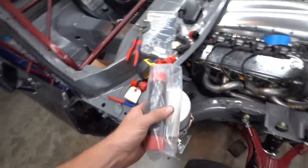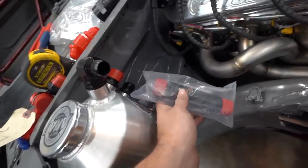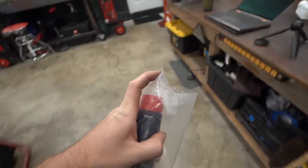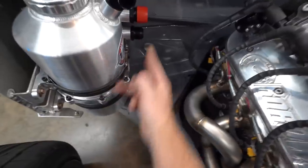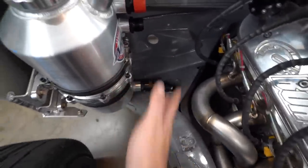We're changing our plan of attack. When I was planning on putting the tank back there, not the most ideal setup — we've just got to use so many fittings, a 90 to a union to this to that. But I found they do make basically the same thing with a 90 built into it, and they're a good bit shorter. So we should be able to do both of them angled that way, and then the lines — everything will be symmetrical, which will make me a lot happier. And that'll give us room, hopefully, to put our breather tank somewhere around here.